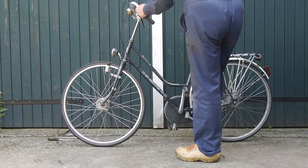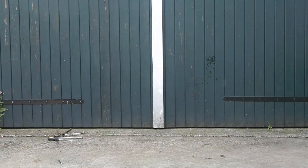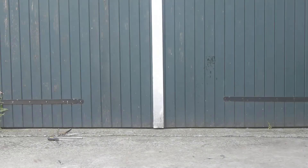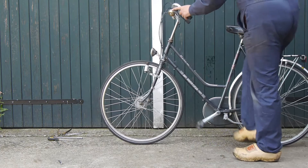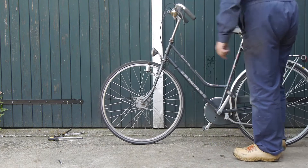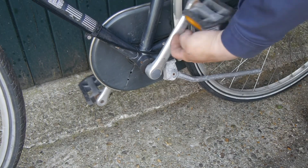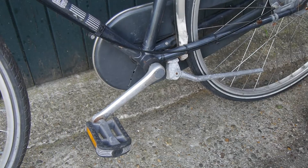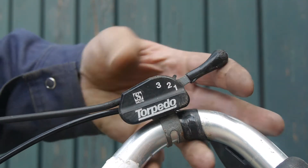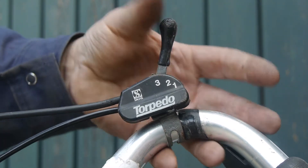Well I'm finally ready for my test ride. This is a step-through frame, so I will use that. Well, that failed — I didn't go far, because I don't have any gears. No idea what this is all about. I'll try to find a gear — and it doesn't seem to matter which position I select. I can see the shifting pin move, but still no gears.